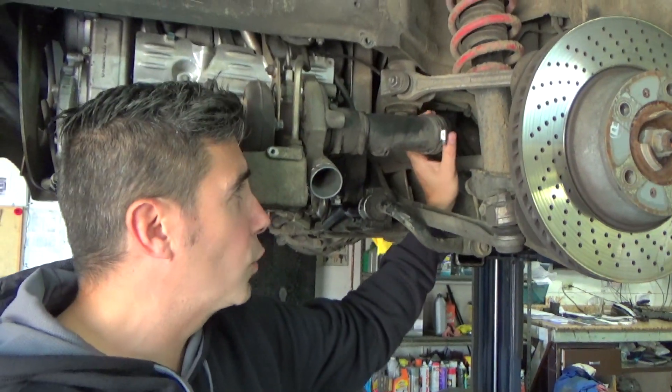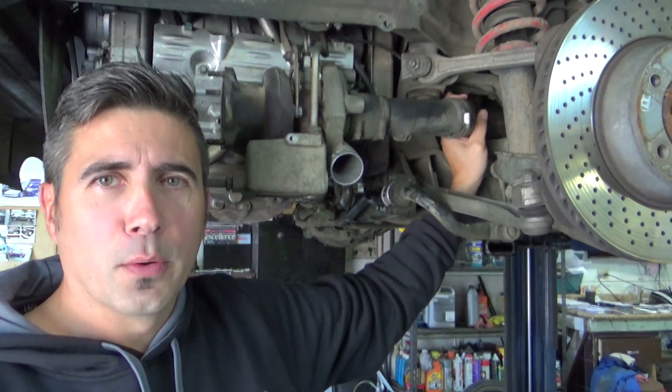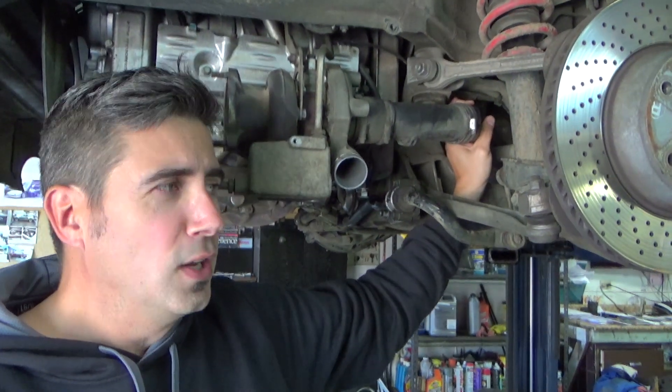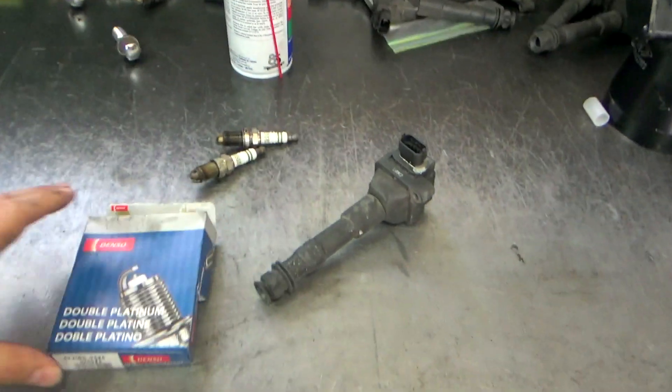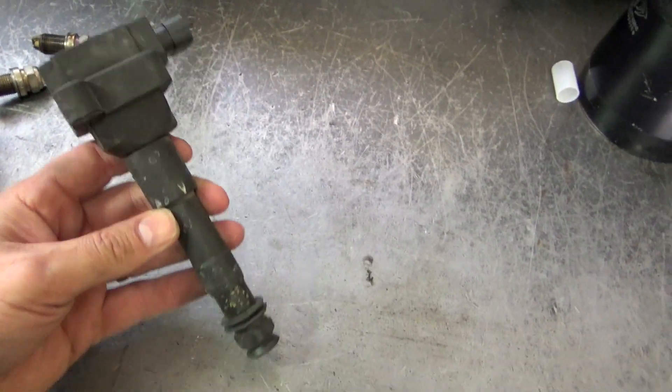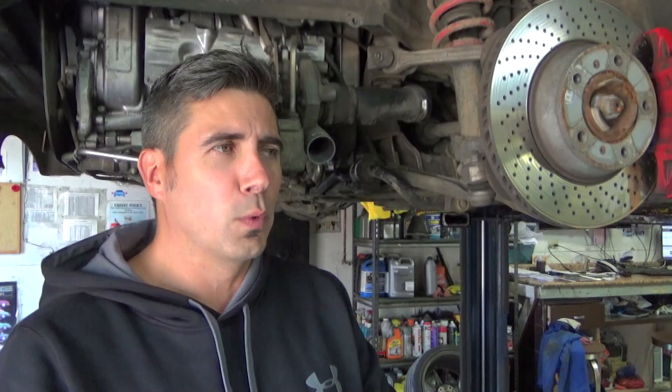That intercooler piping is something Ed will be upgrading shortly, but we're not looking at that just yet. The big thing we're also doing is some background support: we're upgrading to better spark plugs and upgrading to a 997 turbo coil system for a hotter spark. These are the original factory coils from this car, and we're upgrading to the 997 turbo coils. We want to make sure we're getting all the spark and all the air to the system when running this ECU at higher boost — that's obviously a lot of extra strain on the motor, and if you don't do all the right things to support it you could be asking for trouble.